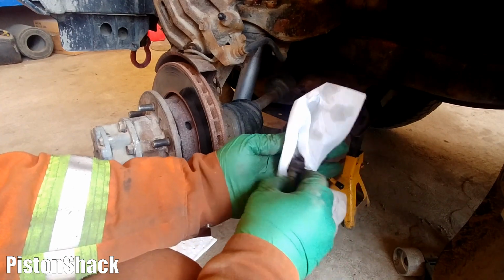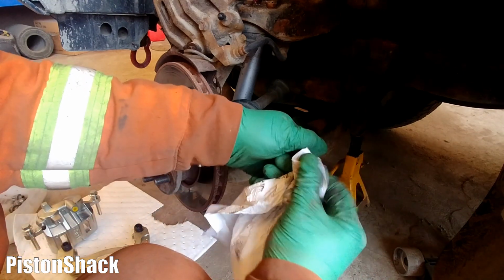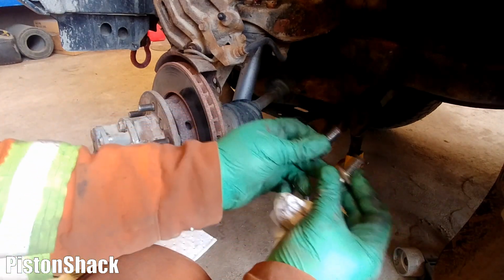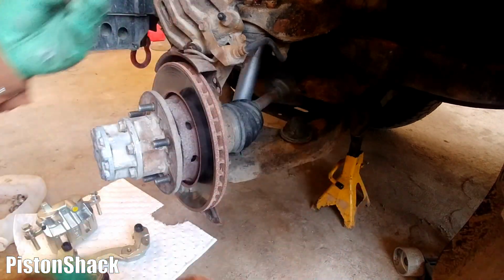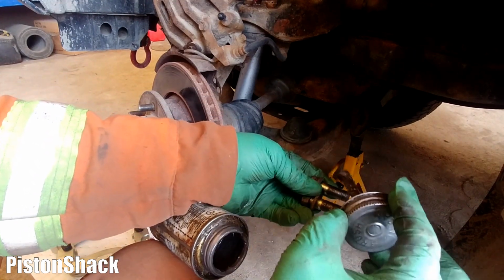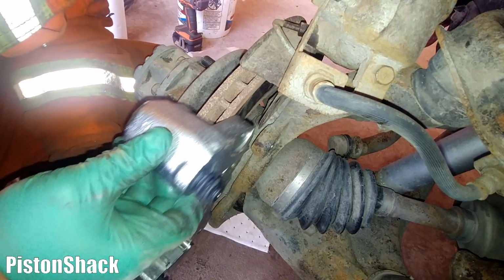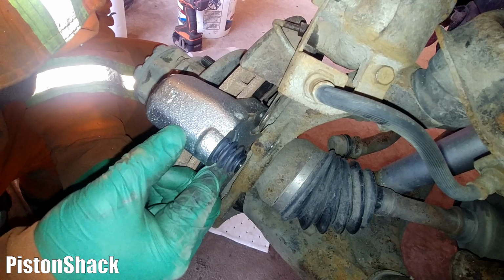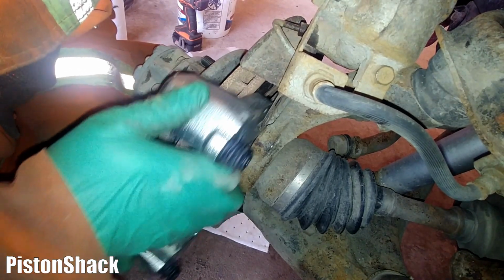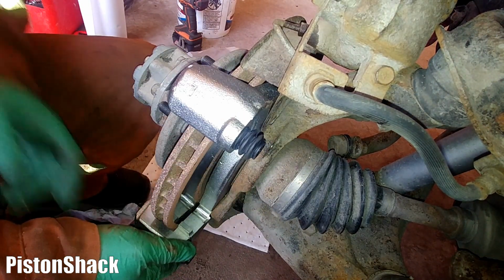Don't assemble dirty parts, especially fasteners. Make sure threads are clean. Yeah, like that. All right, nice and ready. I'm going to apply a very light coat of anti-seize compound, just a little bit. Make sure you can see everything. Okay, let's fit the bracket in its original position. Here we go. Beautiful, look at that. They were made for each other.